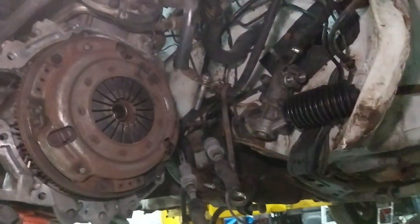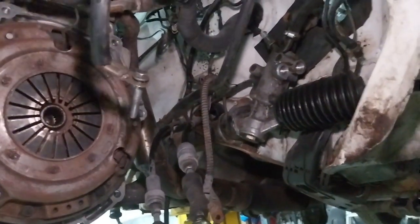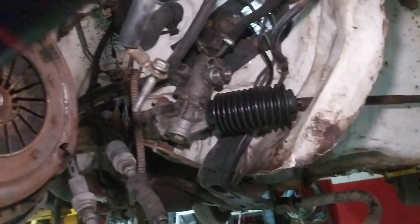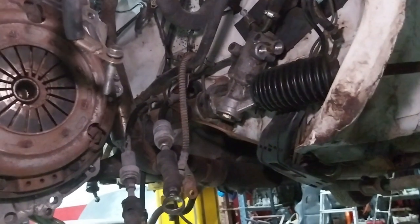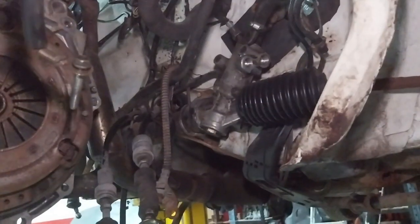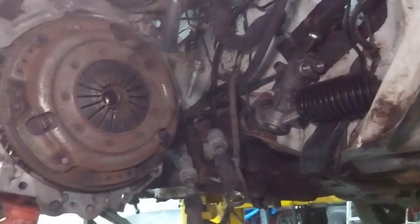While we're here, another problem: the rack and pinion is bust. It's a hydraulically assisted power rack system, and it has sprung a leak in the seals, especially on this side of the rack end. We could repair it, but I don't think it will last, and it is cheaper in the long run to just go for a new rack and pinion — they're not that expensive for the Corolla anyway.